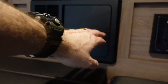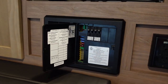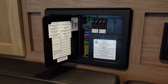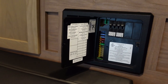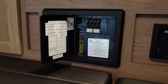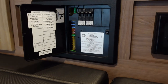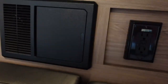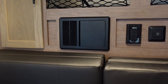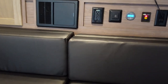There's also an upgraded Progressive Dynamics converter-charger that is fully compatible with the lithium battery. Most RVs come with factory WFCO converters that aren't fully compatible with lithium — they typically charge only up to a certain voltage, thinking the battery is full when it's really only at 80–90%. This Progressive Dynamics unit charges the battery to full. It's a smart charger, meaning it ramps up at full speed when the battery needs a lot of charging, then tapers down as it fills and keeps it topped off.